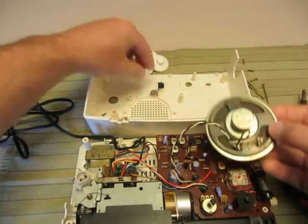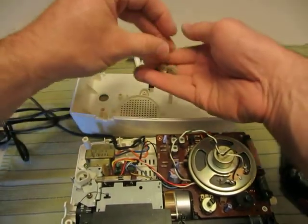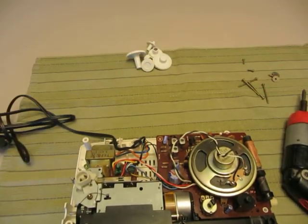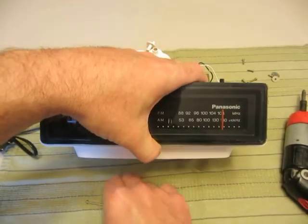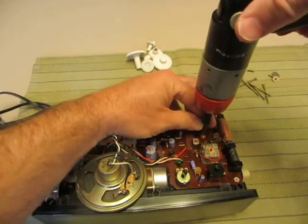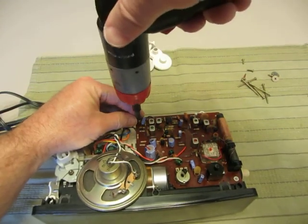Just lift to make sure — what we've got is three washers and three screws. These are hard to replace, so you want to go ahead and hang on to those and put them in a safe place. A lot of times by now I'll put those in a baggie, and I highly recommend that. Then we've got the innards here. We've got two screws on the circuit board itself — one here and one here — and those are going to have to come out. This should be unplugged; you can have some very unpleasant surprises if you're working on a live one.